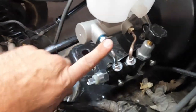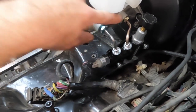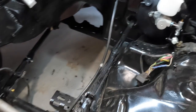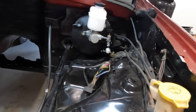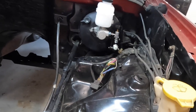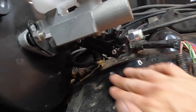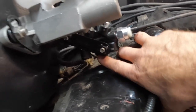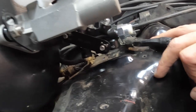That was not fun, but here's where we're at. I've got two lines made — that's all attached and on there. This one here has a slight kink that I'm not happy with — I might have to make something else. What a miserable process, not my forte. Next step, we're going to have to start making the lines. I'll probably have to put on the front brake calipers and run all the brake hoses so we know where those are going to be routed, and use those as a starting or ending point when we build off the bottom of the proportioning valve. We've got three lines coming off the bottom — two fronts and the rear.